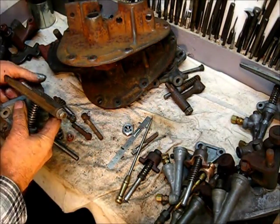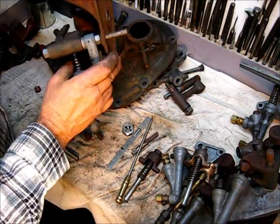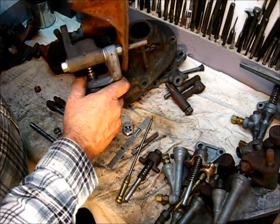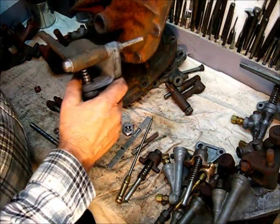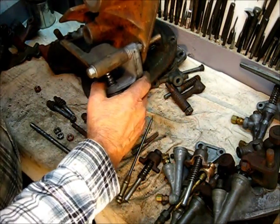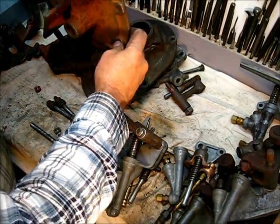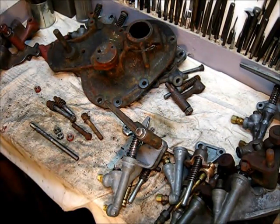If you go back to the early model housing and you use the late model fuel pump on the old-style housing, what happens is you end up with a mismatch in the back. I've encountered several of those where they just stack some washers in there, and most of the time this housing is crooked so your fuel pump ends up in a bit of a crook. It'll work — it's not correct, but it will work. You can actually use the new style on this by spacing it out with a spacer or washer. It's not good practice, but you can do it.